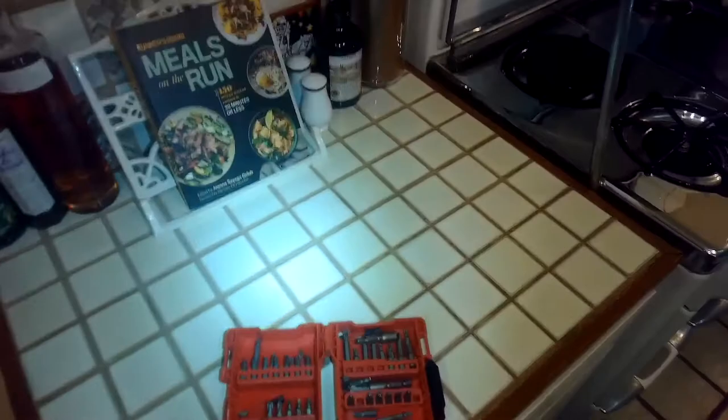Here's the motor. I've got it unplugged and I'm going to pull this modular connector out. I'm going to pry down on the clip and the upper clip holding on the water pump, pull the water pump away, and then there are a couple of little screws I've got to get out — I'll use my quarter-inch driver and a little angle tool. The DeWalt angle tool has been really great because it gets into these tight areas. This motor comes off really easily but the space you're working in is pretty small.